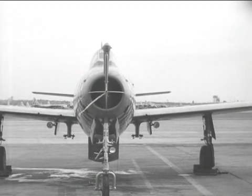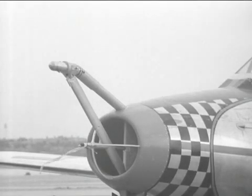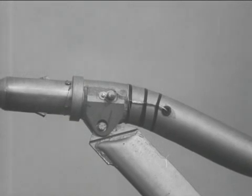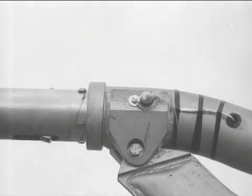To prove the feasibility of the operation, an available F-84E aircraft was used. A probe installed on the nose of the Parasite is used to engage the drogue on the end of the boom. The probe is locked into place by the operation of two spring-loaded latches. The Parasite can be released by retracting these latches and allowing the drag load of the F-84 to withdraw it from the drogue.